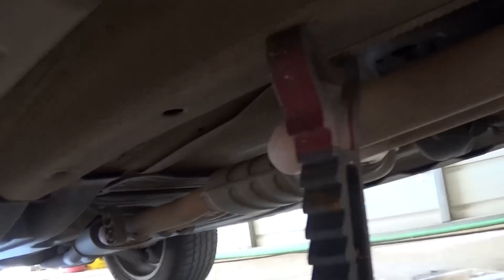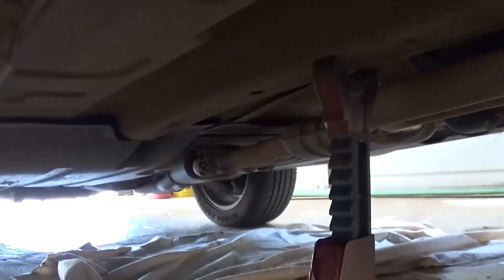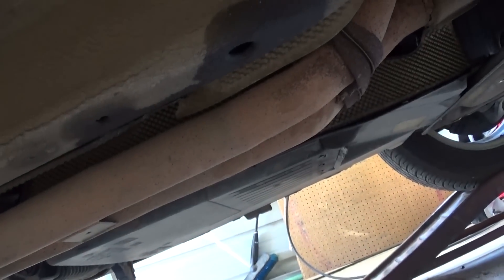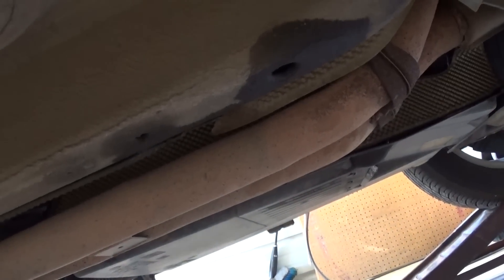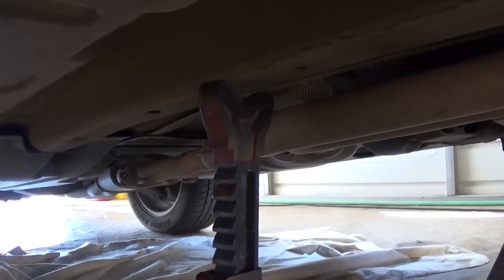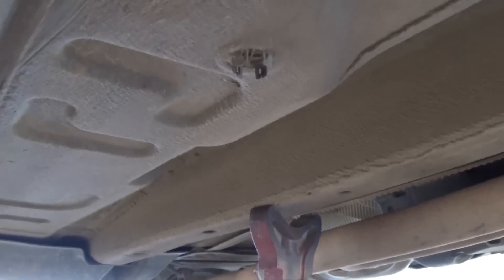In order to remove the drive shaft, we need to remove the exhaust. We drove the vehicle on the stand to show you how you can do it at home. On this vehicle, in order to remove the exhaust, we need to remove these four bolts and they're like welded from all the heat — never been removed and we have the feeling that they will break. So we're going to attempt to just drop the exhaust down a little bit so we can reach the driveshaft without removing the whole exhaust. It's easier to remove it if you can, but if you break one of those bolts, you have to drill it out and it's really a pain to do that.